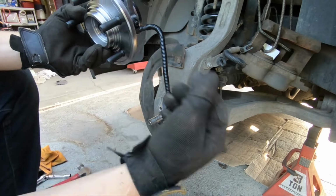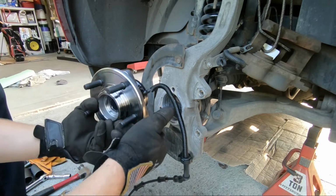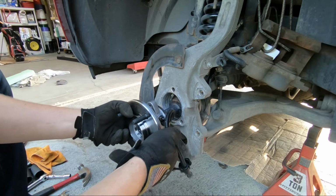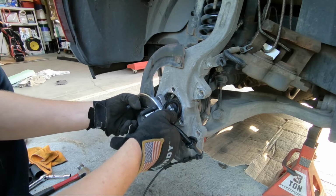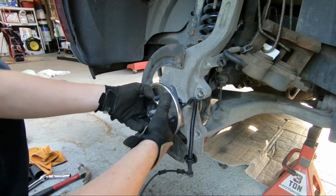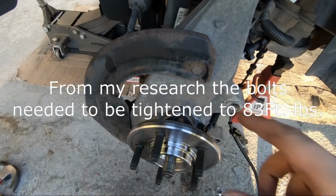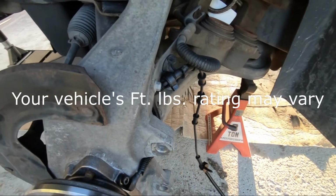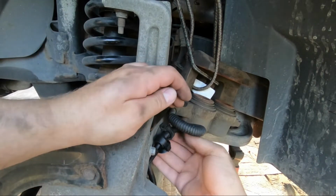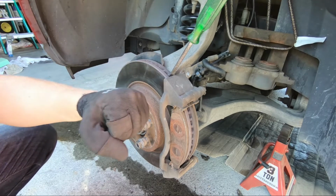I don't know if you can pick it up on camera, but right here is where this wire loom will clip into. So you have to have the wire oriented in a certain way. And that pressed right on, guys. No fuss or anything. Just went on easy. All right, so these three bolts are tightened down. Now we're just threading this ABS line through. So the ABS line is all connected, and I put the rotor back on as well as the caliper bracket